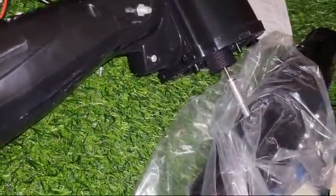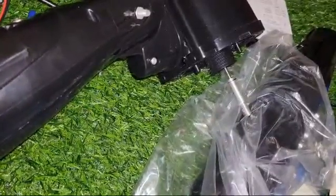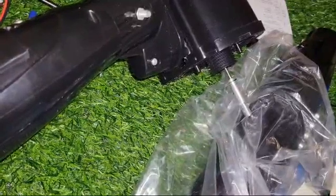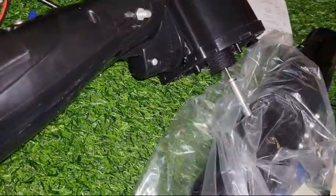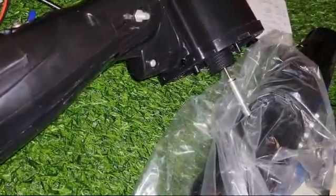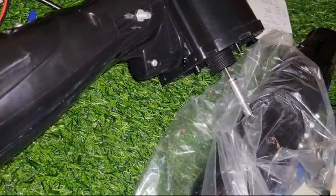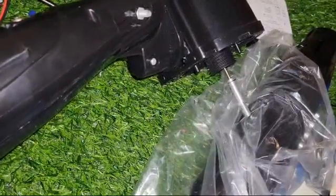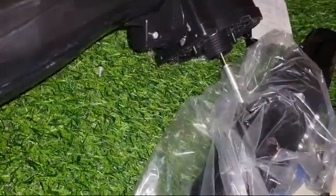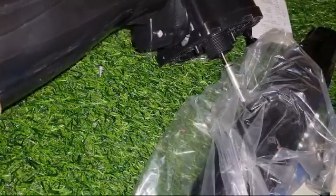Before you do the actual battery change, check to see if there aren't any loose wires, then plug it back into the power outlet to see if it will charge after you fix any loose cords in the solar fan. If there are no loose cords in there, you can safely assume that it is a battery change. You can also test the battery to see if it has exceeded its life or if there is any power left in it before you do the battery change.